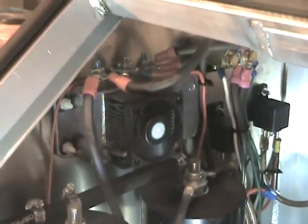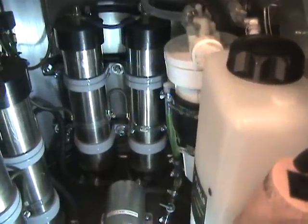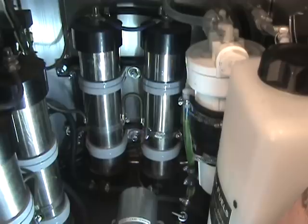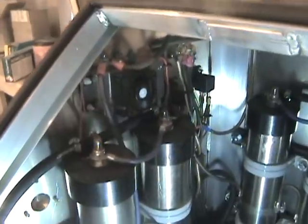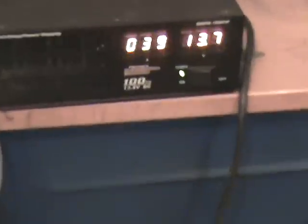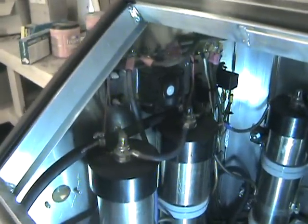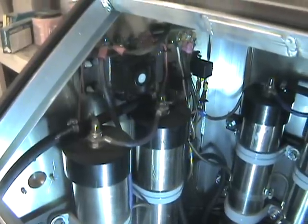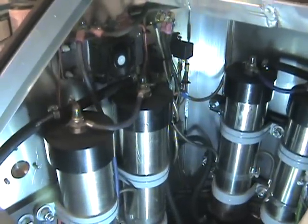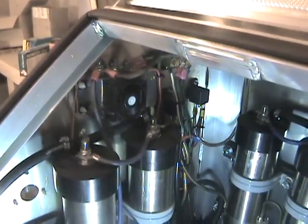The PWM is a constant current pulse width modulator that we use to control amperage. Two of the main things you really want to control in hydrogen fuel systems are amperage and heat. We control our amperage with the constant current pulse width modulator — we can basically dial in any amperage we want. Right now I've got this one dialed in to about 39-40 amps, which you can see on the 12-volt power supply. Systems that don't have PWMs will have amp climbing — it'll start at 20 amps and go to 30, 40, 50 as the system heats up. You really don't want your amperage climbing like that.